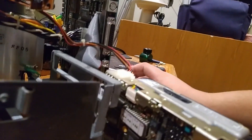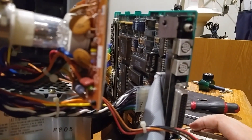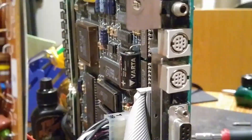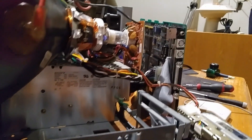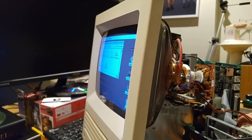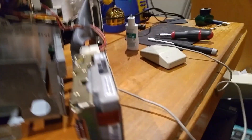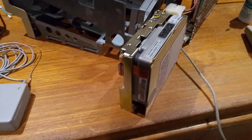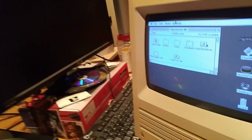I think at this point all I really have to do on this machine is swap out the RTC battery — the fancy West German battery that, after 30 years, is still doing fine. Well, maybe not holding time, but it's definitely doing okay. That appeared to have worked — at least it wasn't booting at all before, and it wasn't just continually doing that same sound earlier, so I'm going to say that definitely helped out.